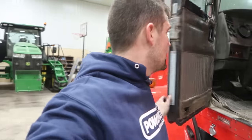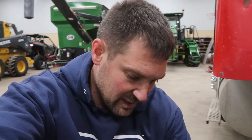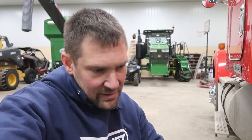Night and day difference - not even comparable - and there's no way those batteries are fully charged right now. Ideally I should leave a low-voltage charger on them all night long, but I've got to leave town tonight. I keep forgetting to mention the obvious, but they fired right up. I am going to have Jim come out here and help me test for draws on this thing - he's a lot better with electrical stuff than I am. If he can help me find a draw on this thing, maybe we'll have something. Right now I'm confident the battery upgrade helped, but it doesn't mean it'll start tomorrow after it sits.